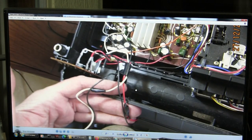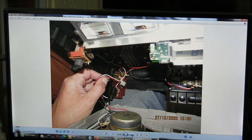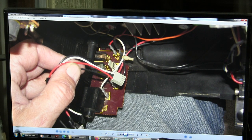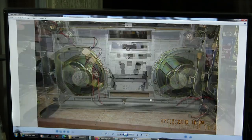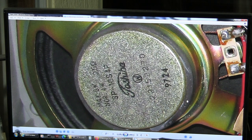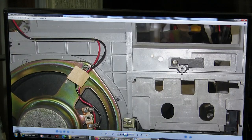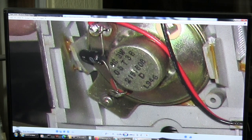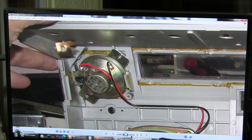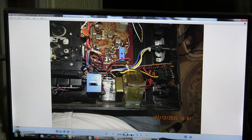Here is somebody nicely wire-taped these together — and that's not good. That was the issue because he had one channel out on the radio. Now, when you unplug the speakers, you take a picture so you know where the things go. The speaker specs: max six watt, normal four watt, and 2.5 ohms. Wow, 2.5 ohms. What are the tweeters? They're eight ohms, three watt. I took another picture of just the botched tape and twisted-together wiring. Then there's the back of the transformer.